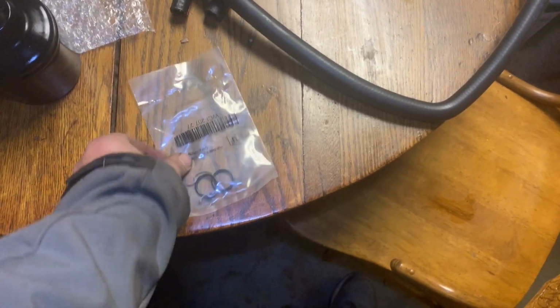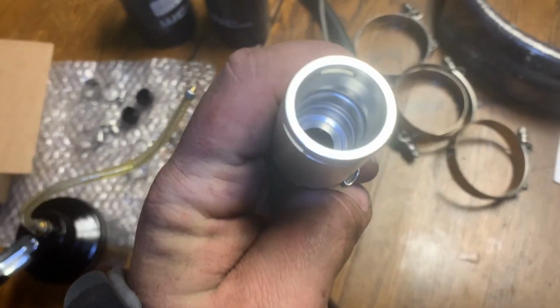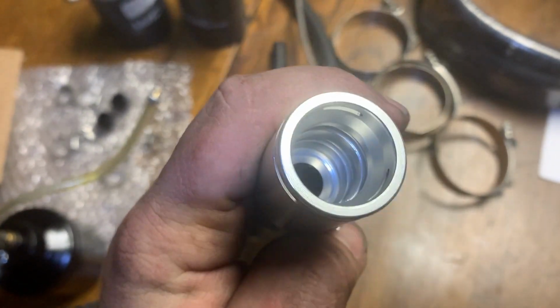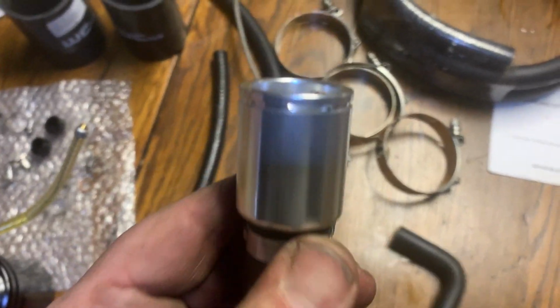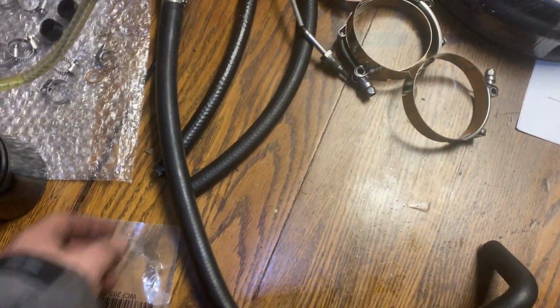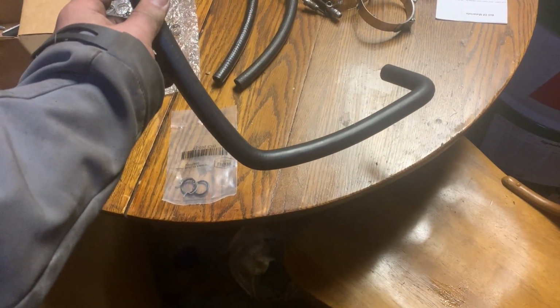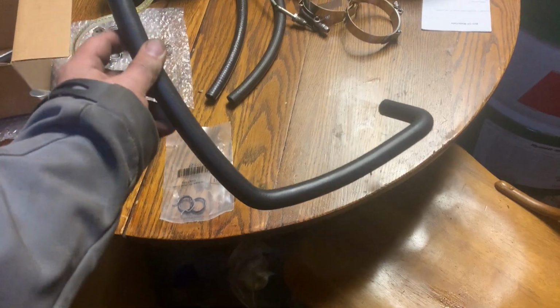We're gonna put on this hose now that the pipe and everything's on, or the intake is on. All right, so you need to take your 2 O-rings. You're gonna put them right in those grooves inside there, and then you see the clip on the outside. You're gonna shove this on, and then push your clip on over it. But this is pre-molded specifically for the Y bridge, which when you're doing the CP3 kit, now would be the time because you're right there.